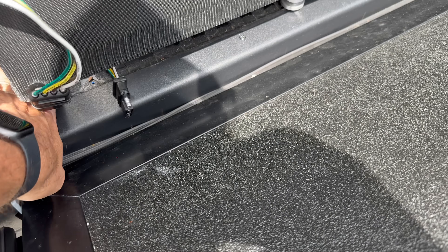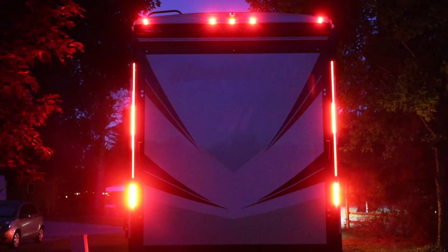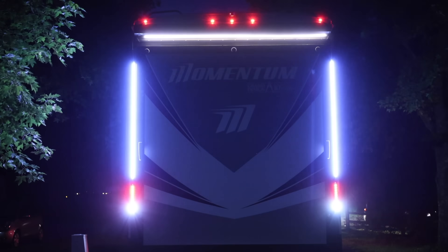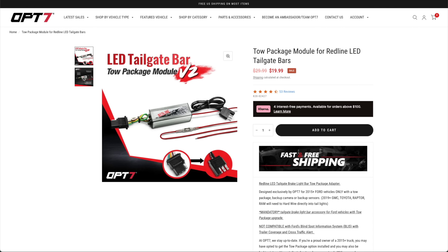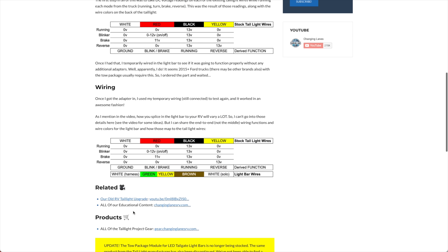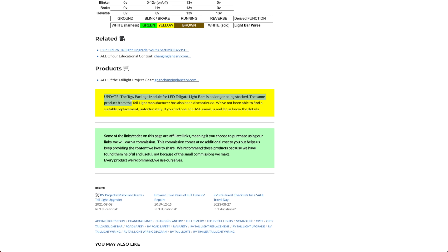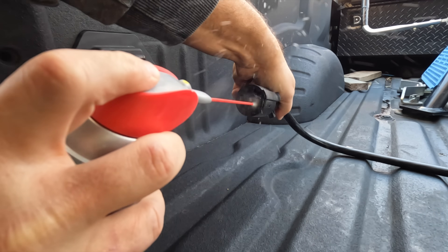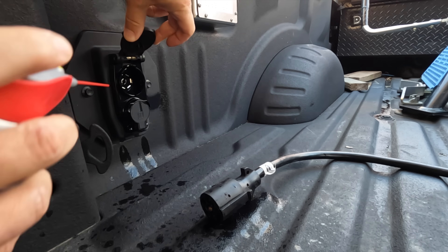Just to eliminate it as a potential issue, I disconnected the little control adapter that adapts our rear brake lights — those strips — to the brake controller, just to eliminate it as a possibility. I disconnected those entirely so they were completely out of the picture. If you're curious about that video and those tail lights, I'll have a link down in the description. Several of you have reached out and said that adapter is no longer available, and I have confirmed that. At this time I have no replacement unfortunately. If any of you guys know or have found one, please let me know, and I will update the blog post. I also checked our seven-way connection and made sure that was nice and secure.